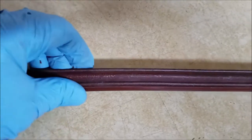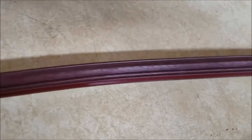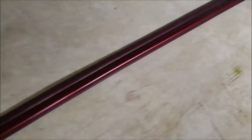The adhesion was near zero. And as soon as it got to the sun — you can see this is the top side of the molding where the sun was, and the bottom side which would be in the shade — the top side just lost all that paint almost immediately. So we've got to go ahead and get these things cleaned up and ready to repaint with vinyl top paint that I got that matches.